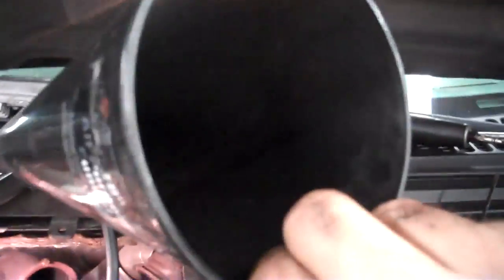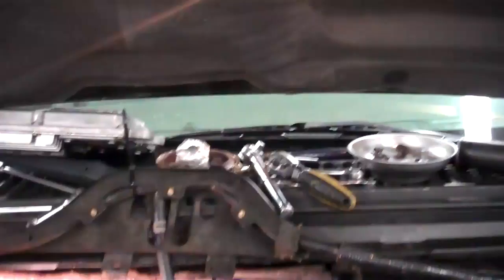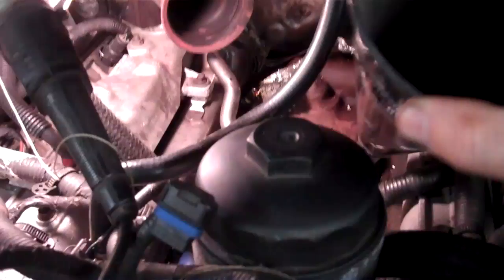I'm using a long oil funnel spout as my listening device. I'm going to look at the right-hand valve cover, driver's side, and I have no noise there. I'm going to stick it in the cover on the passenger side. There is a little bit of mist coming out, so that's a possibility. Now I'm going to listen to the oil drain tube. I definitely hear air coming out of there.